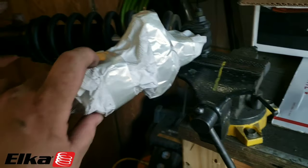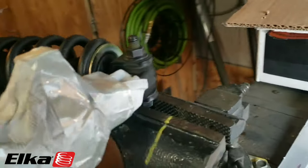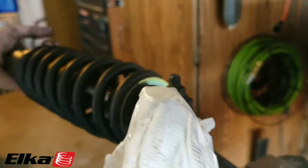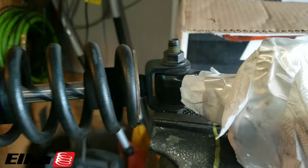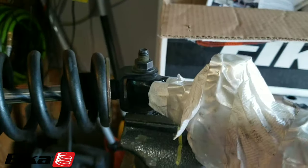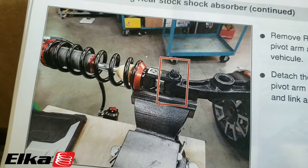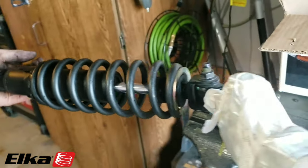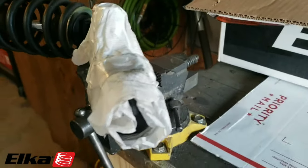Here's what I came up with. Keep in mind there's a shaft in each end of this little arm and needle bearings on both sides. What we've done is put the bolt side in the vise. You could also use an impact and have one person hold that with a wrench. This is a 15 millimeter nut, so we're going to wrench that off. We're going to use the impact gun — I just want to show you this is what their instructions show you to do. We taped all this off so these bearings can't get damaged and no dust or dirt can get in there.